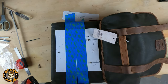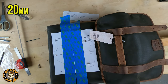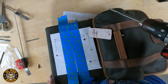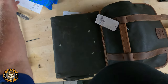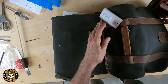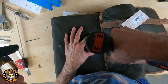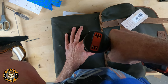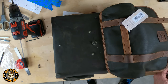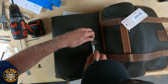Now here's the tough one: this hole needs to be three-quarters of an inch. The reason is that the locking system — where we push the keyhole through — requires that size opening. Before I drill the big hole, I like to come in with an exacto knife and trim the canvas out of the way so everything fits in really nice and neat.